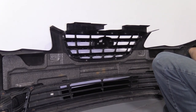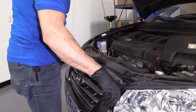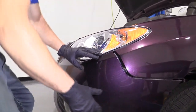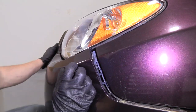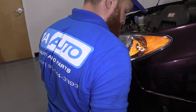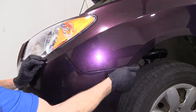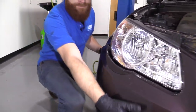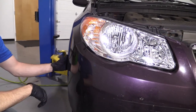Let's mount this bumper up. Let's get our bumper cover up close to the car — we're going to be careful for any paint, you don't want to scratch up any paint. I get it so it's sitting up here. I'm just going to come along the side. There's a little lip right along the bumper cover that needs to go up in here. So whatever you've got to do to make it happen — I just grab into where the grill is, give it a little tug, wiggle it. Give it a little bonk bonk bonk. Screw that in. Same thing on the other side — screw this side in.